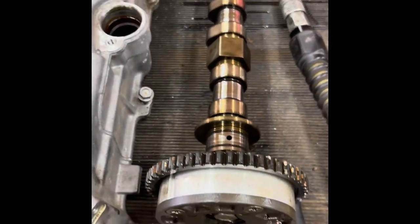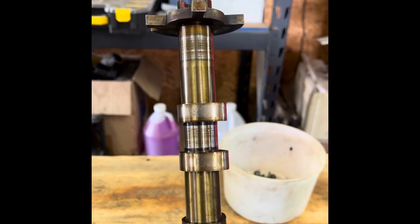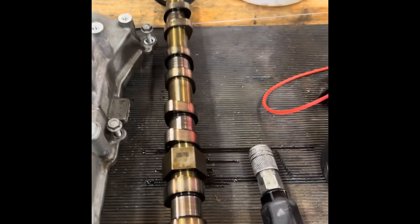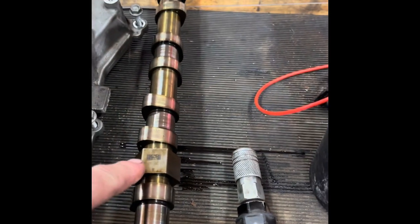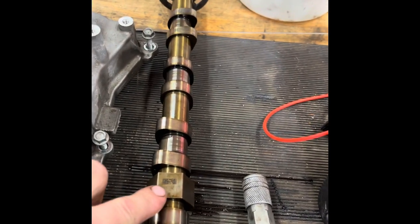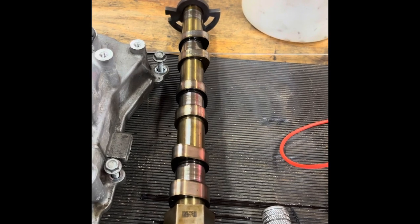I'm going to show you what I'm talking about on that camshaft. This is the exhaust camshaft along with the actuator phaser, and this is the reluctor that the cam sensor reads. The procedure for checking it with the valve cover off is: this hex right here has a laser engraving — a part number and kind of a QR code. That's the only side of the hex that has any marking. You basically rotate the motor and put this marking at 12 o'clock, and this long tang on the reluctor gear should be straight in line with that.